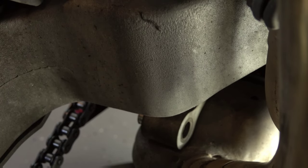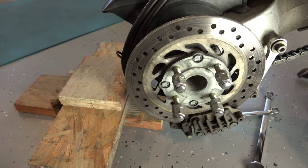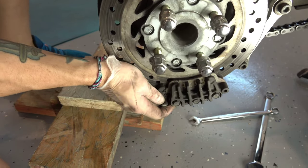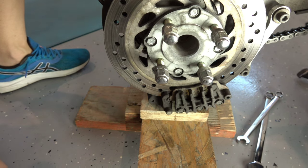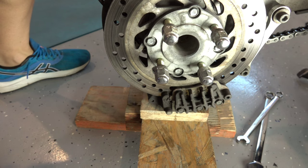I was completely wrong and I have to admit it — I never saw coming that the portion that was going to drop was the swing arm. I learned that the hard way. The triangle is keeping the geometry with the swing arm, so instead of just applying pressure under the bike, what you actually want is to put something underneath your swing arm so it doesn't go down, and that's going to help you put the triangle back together.